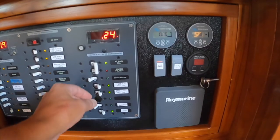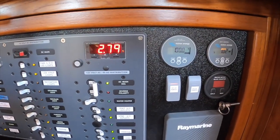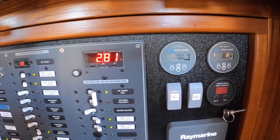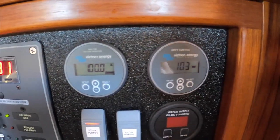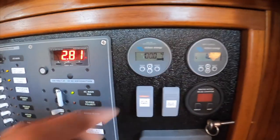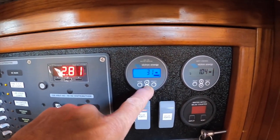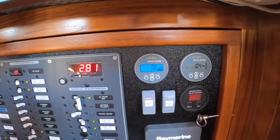Sometimes we don't eat at all, just have snacks or eat out of a bag. Last night we had pizzas, and the night before I had a peanut butter and honey sandwich — that took zero amp hours. Okay, power is off. Cook top's on — there's that parasitic draw — so we always turn the breaker off when we're not using it. We're making 103 watts of solar, batteries are at 100%. Let's start from zero amp hours and see how long it takes to cook the turkey.